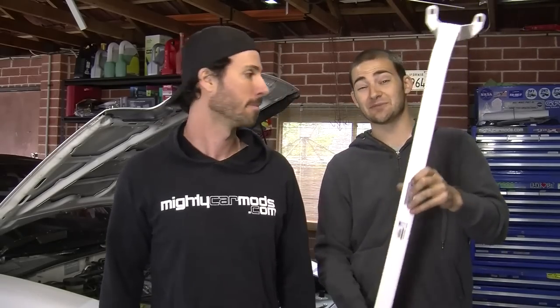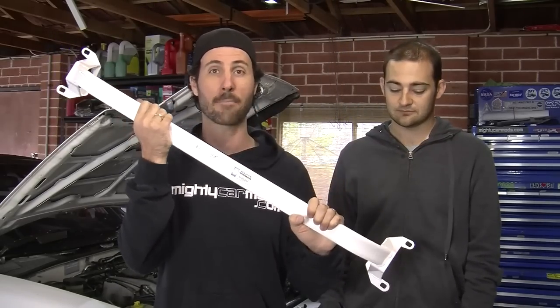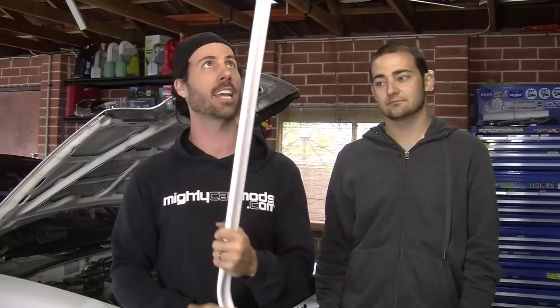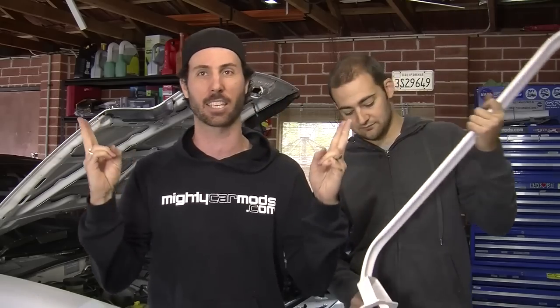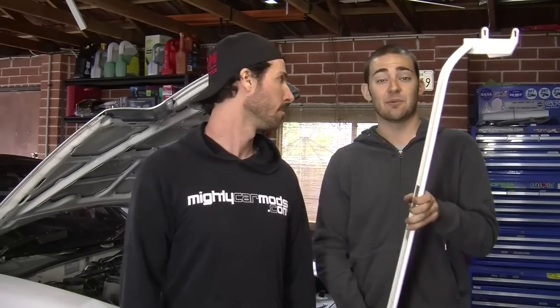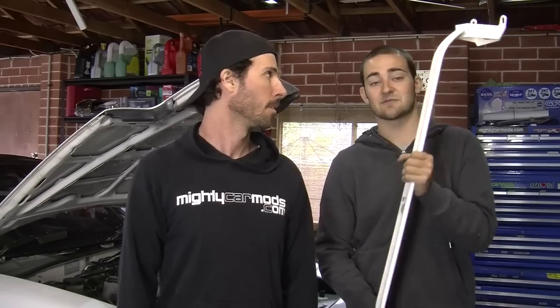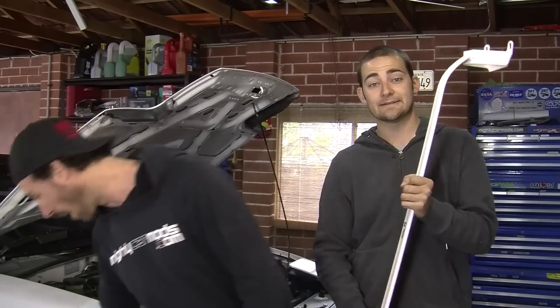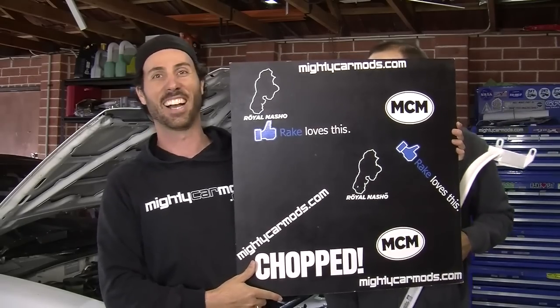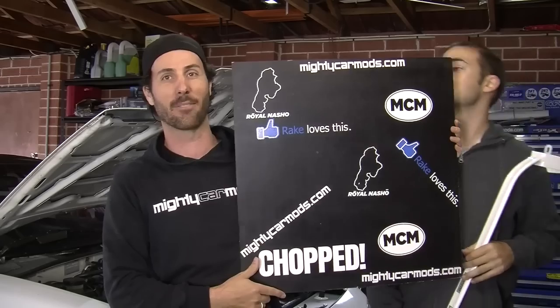Now, the final piece of bracing is this front strut brace. These things are cheap and really, really easy to install. The manufacturer says they're actually designed to absorb some of the impact in the unfortunate event of having an accident, which means you don't get as much chassis damage. There are only four bolts to put on — some use six bolts — and they connect the two front shock towers together. Now, it's not a handling cure-all. It's not going to make amazing differences. But it's all about doing small incremental changes to make it better. It's probably one of the cheapest and maddest mods you can do. One of these high-quality stickers is available from the MightyCarMods.com website — a lot of people are always saying that's a cool sticker. You can get them from MightyCarMods.com.